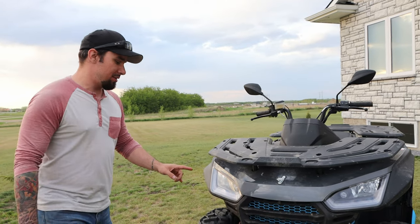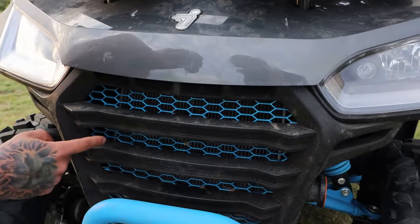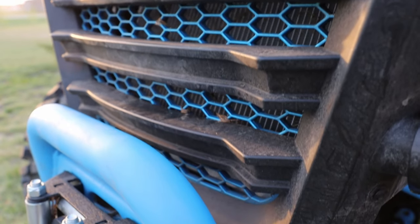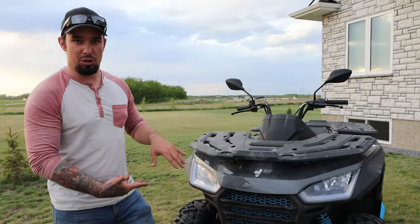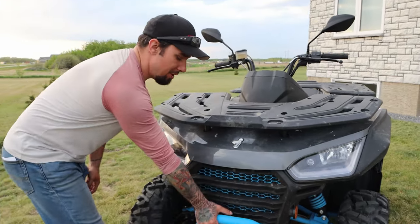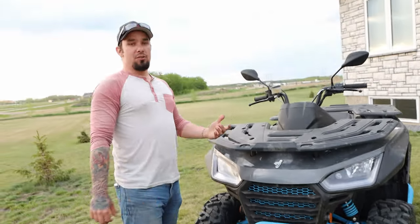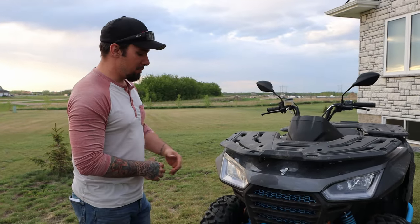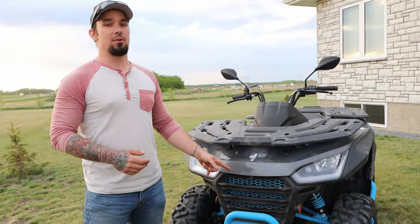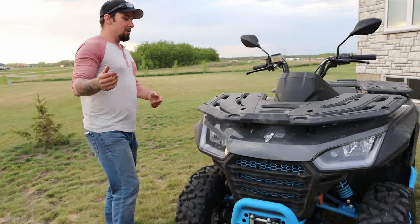The only thing I didn't enjoy is this shroud protecting the rad — although it's good protection, it makes it very difficult to clean inside. If you're on the trail and have to wash it, it's a bit of a pain. The bumper, though, I thought would be flimsy, but it's actually really well tied into the frame and it's what holds your winch entirely. The winch is basically an off-the-shelf 2500-pound unit with Segway branding — it works very well. It does have steel wire rope, and while a synthetic option would be nice, it works fine.